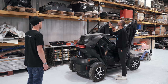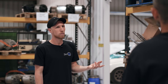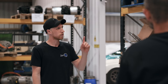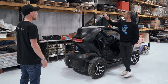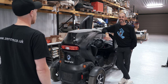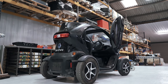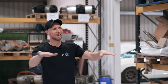What's that? It says Tesla on it, but it's actually from a B-Class Mercedes. On paper 28 kilowatt hours, but actually they're 36 kilowatt hours — the pack is just restricted. The G-Wiz fits four of those modules in as they come — so you can upgrade a G-Wiz with just a few bits and have 12 kilowatt hours. I nearly hot-rodded a G-Wiz for laughs, but I valued my life. These are far superior to G-Wizzes.